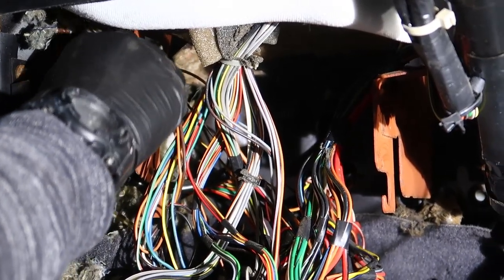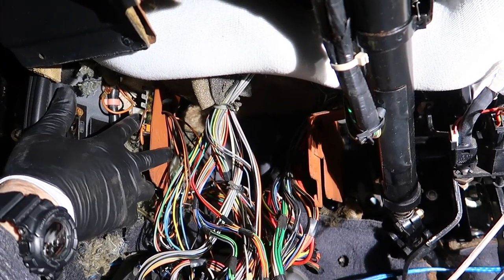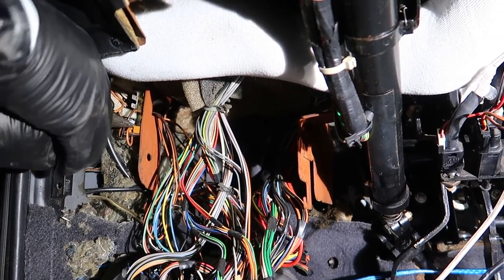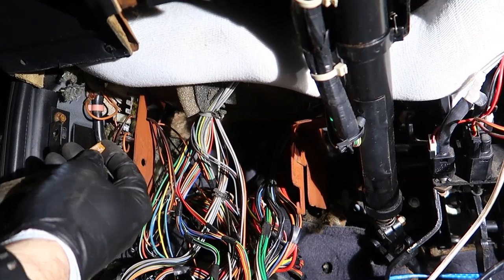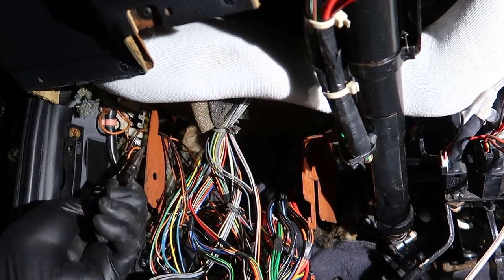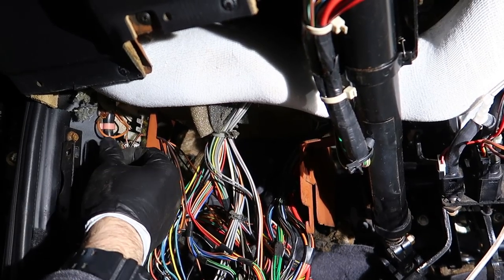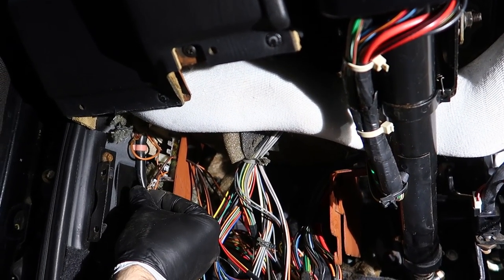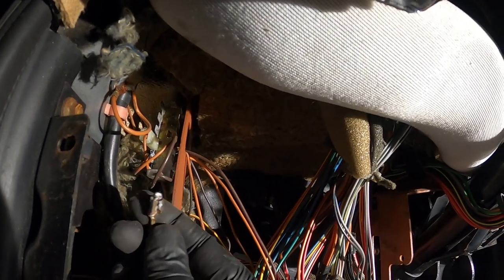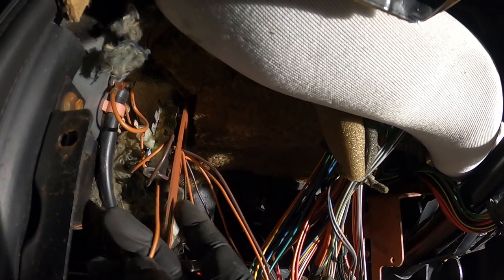They're probably going to fight me because it's natural. Oh, yeah. These things do get very chalky. If you have issues with electrical, the first thing I do is, oh my goodness gracious, it broke. It's just the outside sheathing. It is a ground, so you're not hurting anything. It's very chalky, and you'll get all kinds of crazy little electrical issues with just a poor connection. This chalky stuff is really normal. You just want to clean it off.